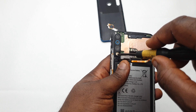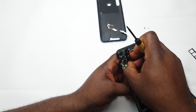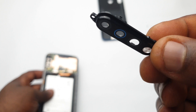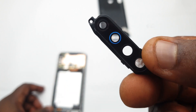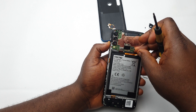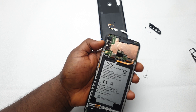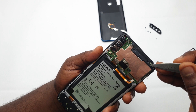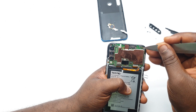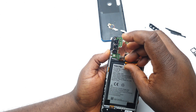Next, I'll take the screws off that hold the glass covering the camera in place. As mentioned, it's just regular glass that can scratch easily but won't be as bad as plastic. I'll also take off these three screws up here that hold the plastic guarding the selfie camera, the board, and the earpiece. Once done, you can use a flat screwdriver and carefully raise the board, ensuring you've unclipped all connectors for the screen, battery, and everything else before you lift the board off.